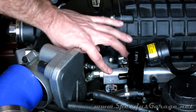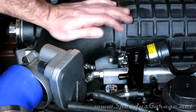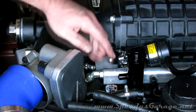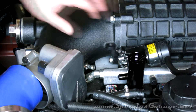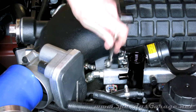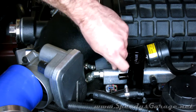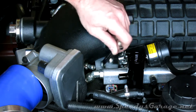The clearances are really tight around the fuel rail. Mine has a modified fuel rail — it's got a 3.8 spacer underneath it for the taller 80-pound Ford injectors. So I have a little bit tighter clearance than you might on yours. I don't want to take the fuel rail off because then you risk crimping or pinching an O-ring on a fuel injector and creating more work. What I ended up having to use was an old-school 12mm non-ratcheting crescent wrench. I had to take the oil cap off to give me room because you get about a quarter inch of a turn one way and then a quarter inch the other way. It's time consuming, but that's how I did it.